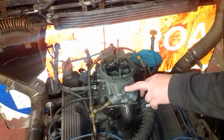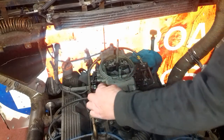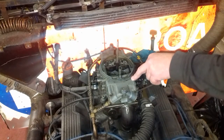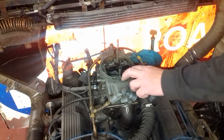The beauty of the Holley is if it's running a little bit rich, all you can do is just play around with the jets. You've got your primary and your main jets. They're incorporated in these little valve bodies here. Just have a look at the jets that you've got, the sizes, and you just go down one or two sizes. It's best to jump two sizes at a time. These carbs are fantastic — they're fully tunable.